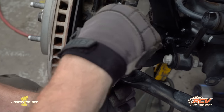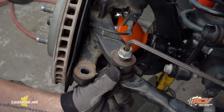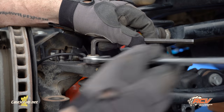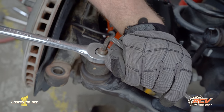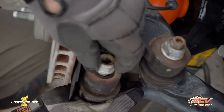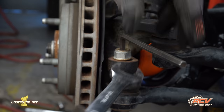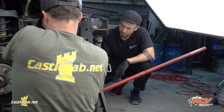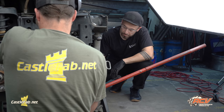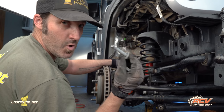Now we're going to install the drag link. To reinstall the drag link, since it's not seated in the taper, you'll have to use an Allen wrench and a normal combination wrench. Now it's time for the steering crossover link — same applies as the drag link; you will need to use an Allen to hold the shaft and a wrench to tighten. Unfortunately we jumped the gun — I've got to remove this side of the steering crossover link to put the stabilizer shock back on because the bolt won't fit in. Now that the steering crossover link is removed, we can insert the bolt for the dampener shock.